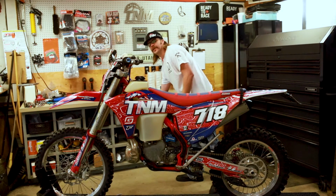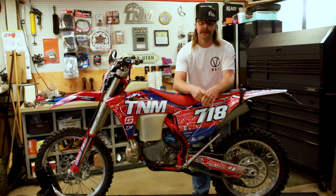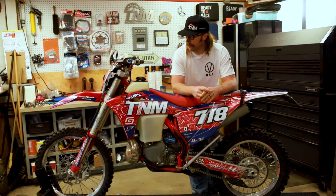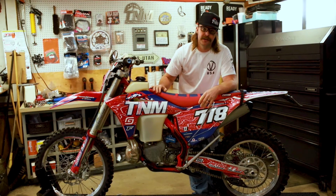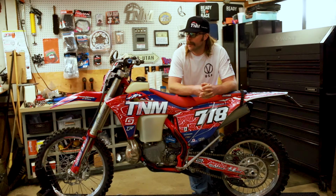We usually have both these fan kits in stock. They are not on the website yet, but we kind of save them for bike builds that we do because they've been on back order for a while. So this bike has a TrailTech kit because it's an EX. I set my thermostat to 195 degrees. You want these bikes to get up to operating temperature and run right, so that's kind of my recommended setting on the fan kits of where I would put them.